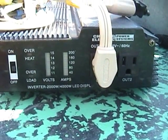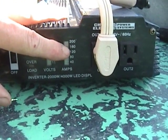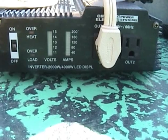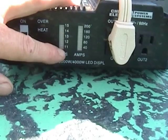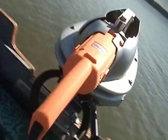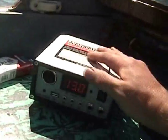The inverter here is a 2,000 watt inverter, 4,000 watt surge. When we turn on the motor we're going to see just how many amps it draws — it's going to draw quite a few. I think at full power it's going to be up around 140 to 160, could be less — I'm hoping it will be. This shows our voltage; 12 volt system should be around about 13, all the way down to 11 and 10.5.